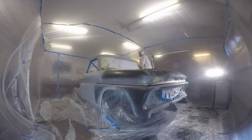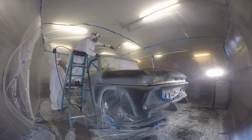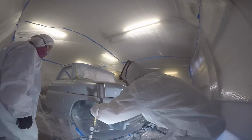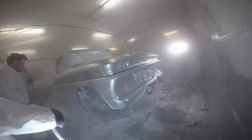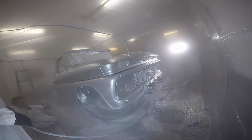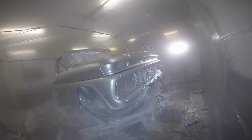My final desired color was a Harley-Davidson satin metallic silver, which is inspired from Ike's 2009 Sportster Iron 883. Since I was starting with multicolored body panels, my first layer was a coat of sealer. The Harley-Davidson paint was incredibly expensive, so I first laid down 3 coats of a similar but inexpensive General Motors silver to get the color close, and then topped it with a layer of Harley-Davidson paint. I topped it all off with 3 coats of satin clear coat.